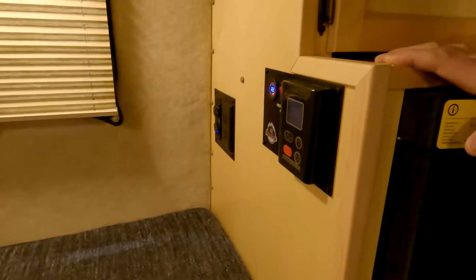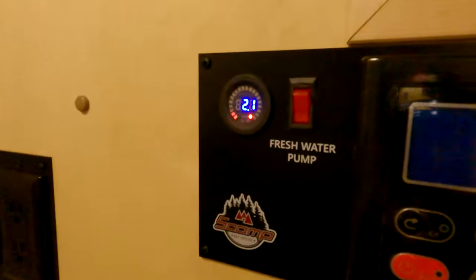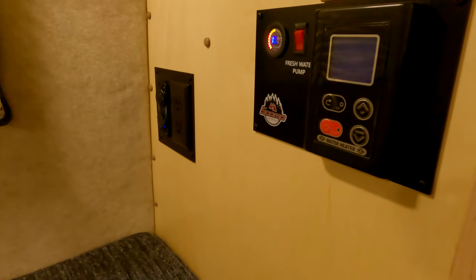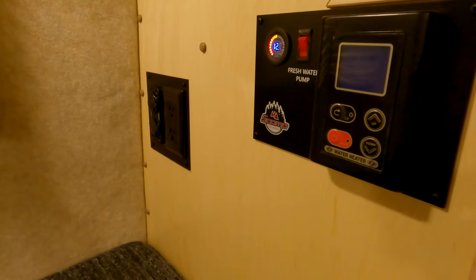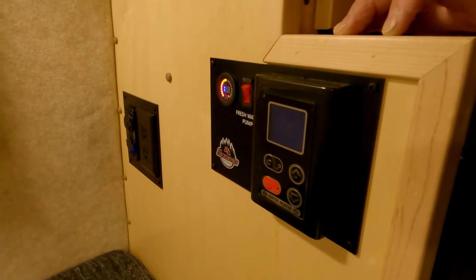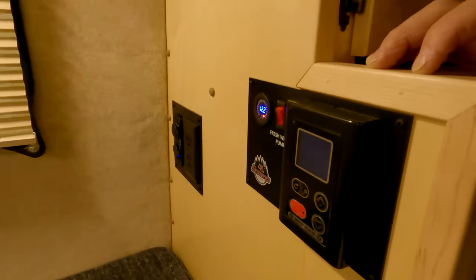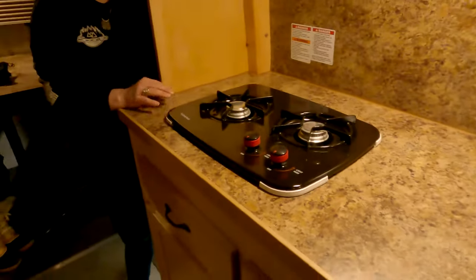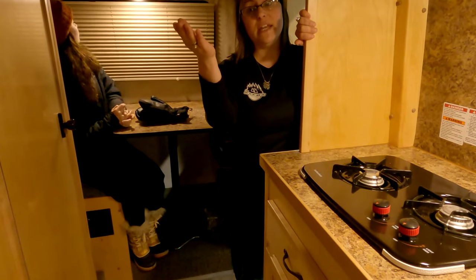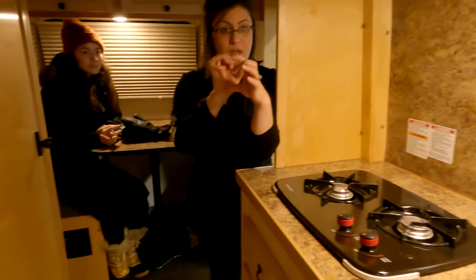On that wall you have a voltmeter — a little round circle — and that shows the voltage of your battery on the front of your trailer. It's a deep cycle marine battery, so in Minnesota winters, bring it inside unless it's on a trickle charger. When it gets down to 11 volts, charge it — they don't recommend draining those batteries completely dead because you'll lose the life expectancy. You should also have a black box over there with a little red power button — that is for your on-demand water heater.